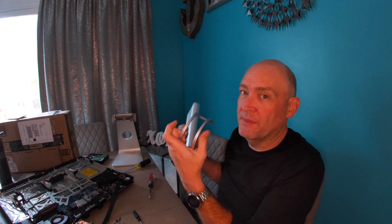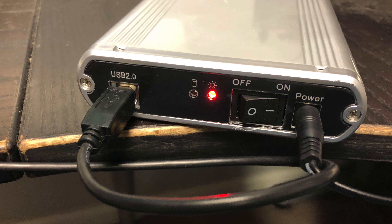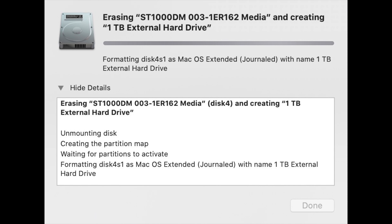And that's that. I think there originally was a face plate that went across here, but I think it got misplaced — all that really did was look a little prettier. It did come with a stand too, so you can put the hard drive in the stand. Our last step will be to plug in the hard drive, plug it into my existing computer, plug in the power supply, flip it on, and see if this thing even works and if there's any data on there that I still need. In the end, the hard drive worked but there was no readable data on it. I'm not exactly sure what happened — I don't know if it was a different format, if the data was corrupted, or the hard drive was very old. But it is a functional hard drive now and I was able to format it, so now I've got a free one terabyte hard drive.